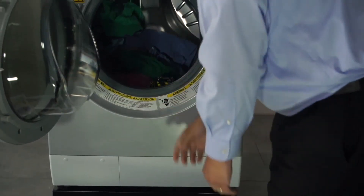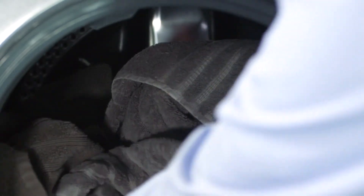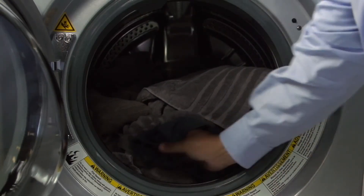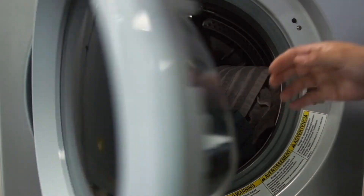Place a few garments at a time into the washer so that they're not all bunched up into a ball. You want to make sure that you don't fill the drum with too much. For best wash results, there should be some room at the top of the tub, like this. Be sure nothing is hanging out of the door. Once all of the laundry is placed in the machine, close the door all the way. The washer won't start if the door isn't closed completely.